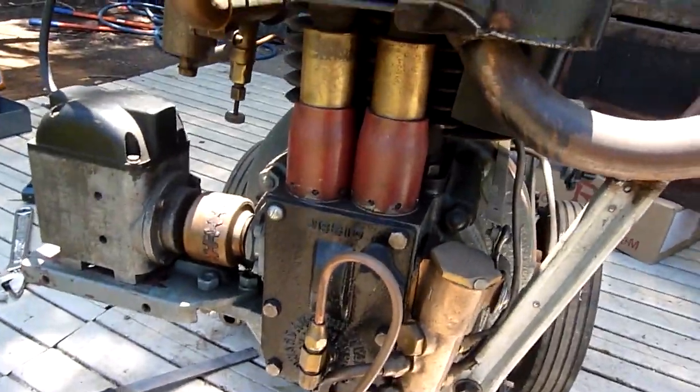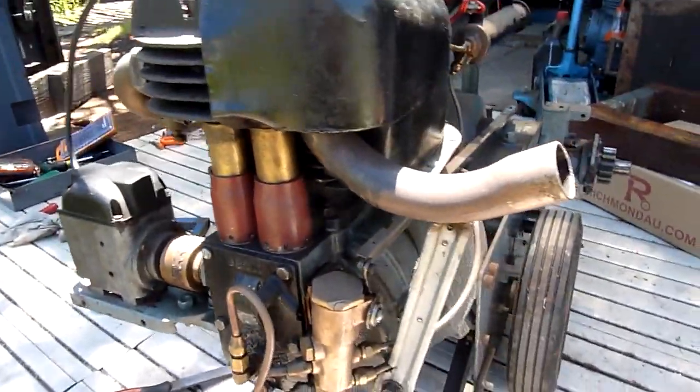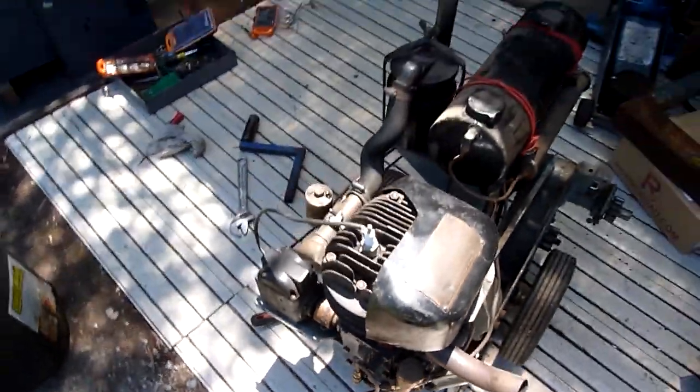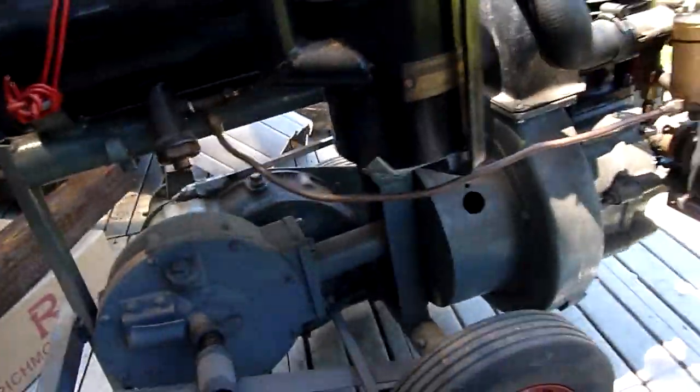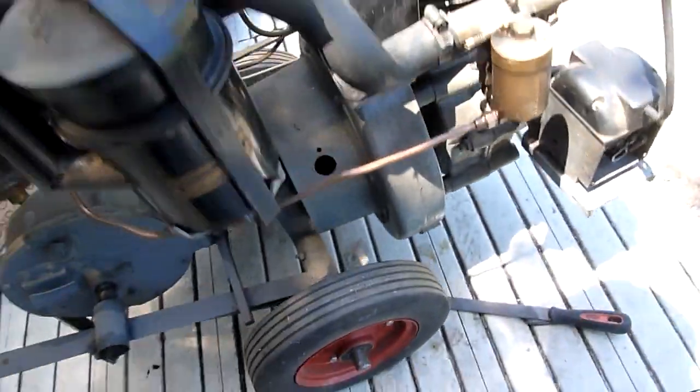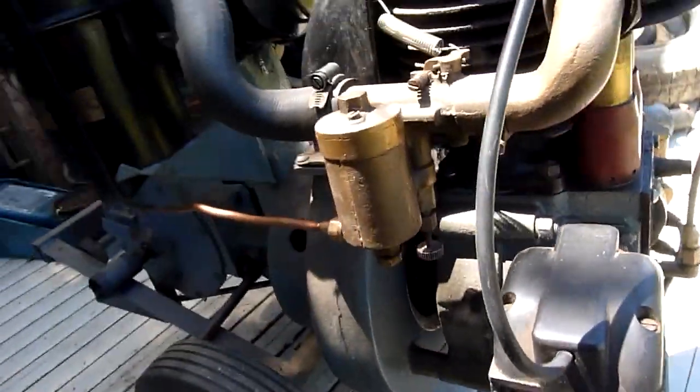It doesn't run properly. Someone's bored it and put new rings on it, but they haven't replaced the piston, so there's about 2 mil of piston slap. You'll hear it, hopefully, over the exhaust. But it's still sort of worth keeping. Definitely not going to scrap it, I'd rather sell it.